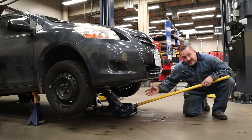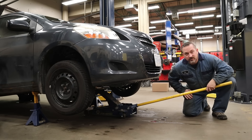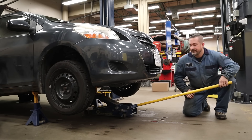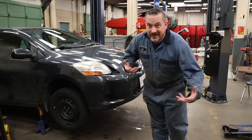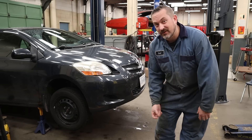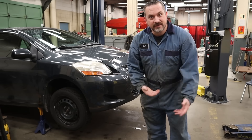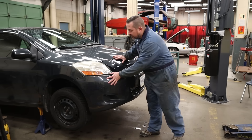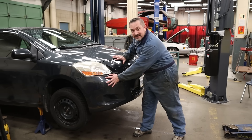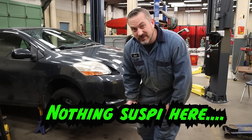If you do need the room — say you're doing an oil change — just lower the hydraulic floor jack and roll it out of the way. At this point you're ready to get in there and do some work. But there is one thing we can do to make this 100% safe: go to the front of the vehicle, give it a good shake, and make sure it's stable. Make sure nothing is going tippy and could possibly fall on you once you get underneath the car.